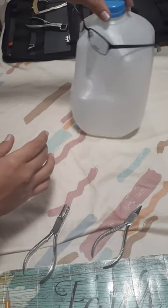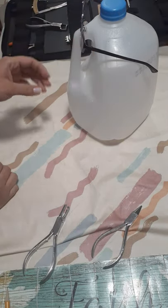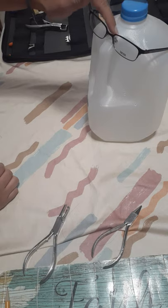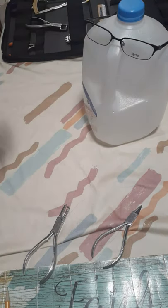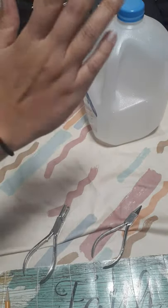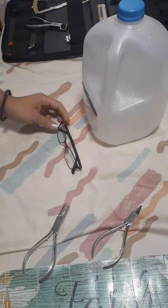What I do notice on this specific pair of lenses is that it needs a little bit of front angle, okay? It does need a little bit of front angle, but we're not gonna do it on this video. Front angle was the first video, okay? But it would help to have a little bit more frontal angle, okay? But this was splay, okay? This was splay pad misalignment.